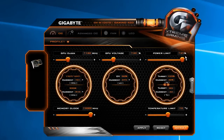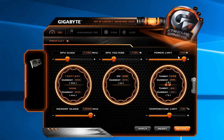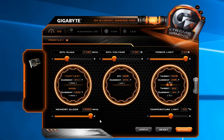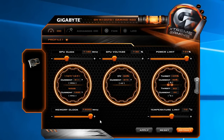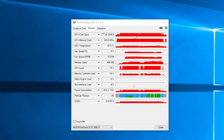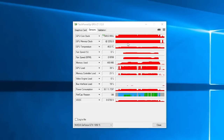With these settings I was hitting around 1940 MHz on the GPU clock speed at its peak, but mostly around 1900 MHz. The memory was stuck at 2252 MHz since I couldn't move the slider further in their Extreme Gaming application, but it was rock stable at that frequency. You could probably find a workaround to push it even more — I know it can be done with MSI Afterburner if you edit a certain settings document to enable unofficial limitless overclocking.